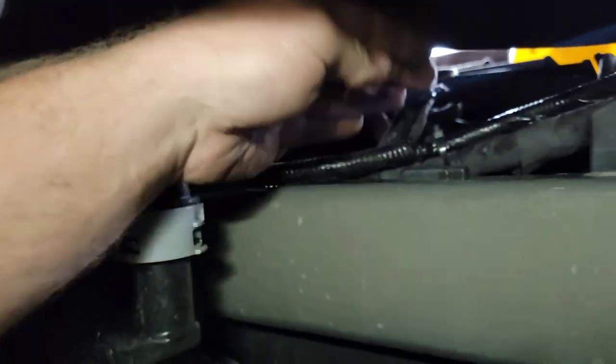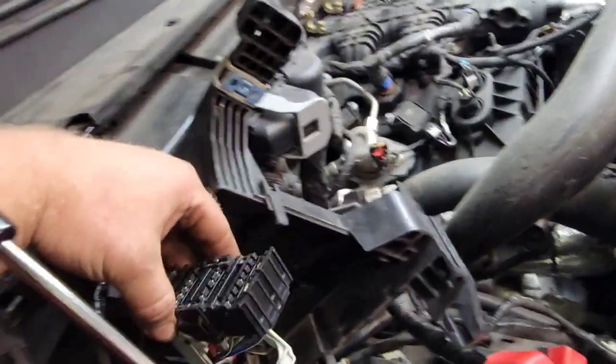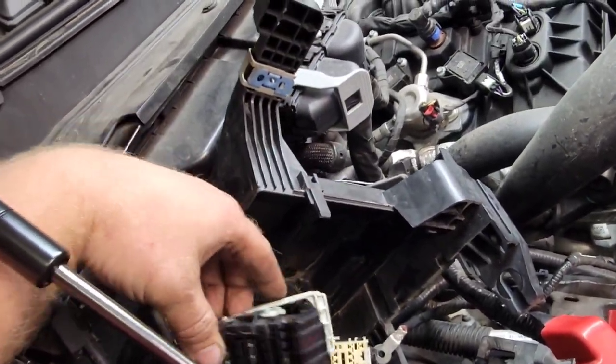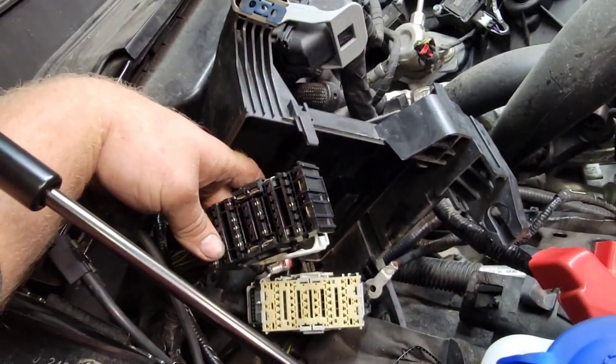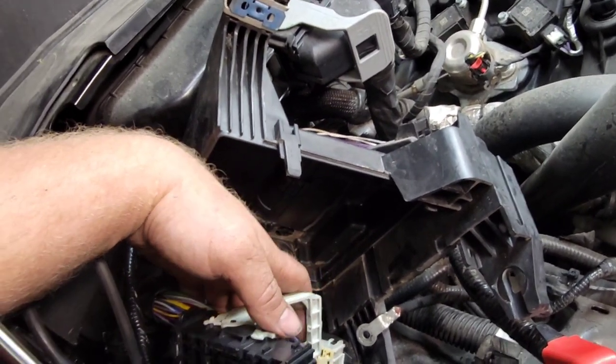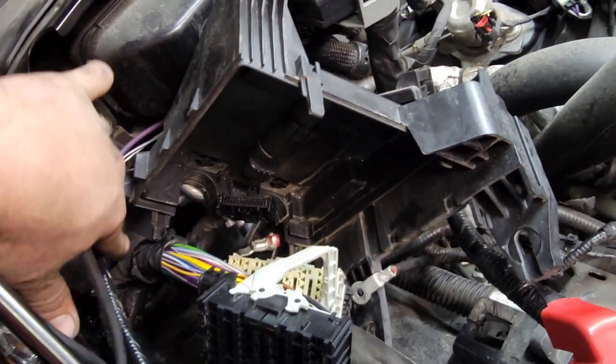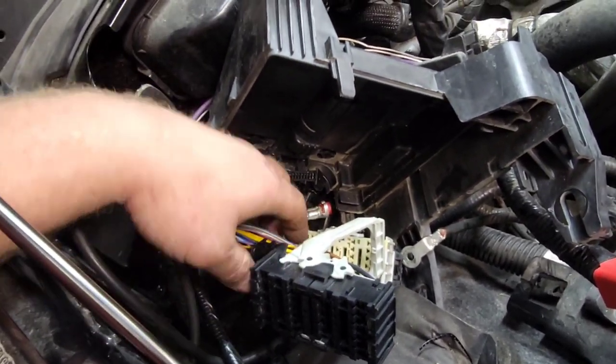And then I continue with my harness on over, and now I'm working my way back up to the fuse box again. I jumped ahead too far — I should have done this connection before I did the harness. The directions have me go back and find the black connector that goes to the computer. They want you to take the shell off the back of the black connector, then peel back the cloth tape as much as possible — it says 300 millimeters.